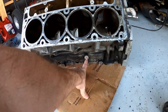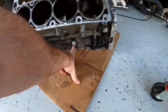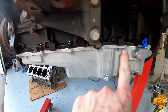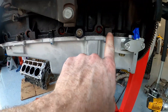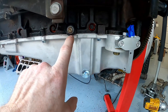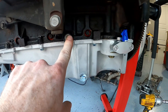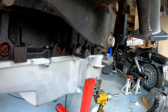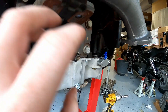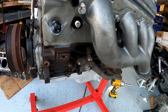...is that an LS2, at least for my 2006 Trailblazer, had these side knock sensors — this one threaded in here. The LQ4 block does not have that. So what I had to do is use one of these stubs: I had to drill and tap a stud and put in one of the knock sensors here. This is basically what it comes out to look like. The wiring is going to be able to sneak behind here and not interfere with anything on this side.